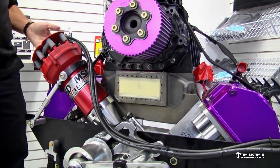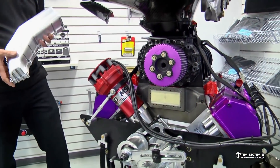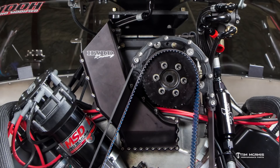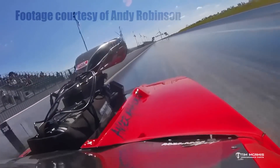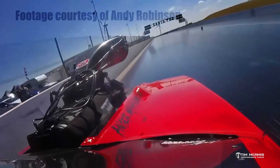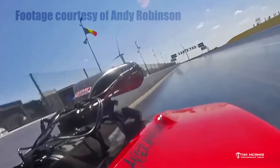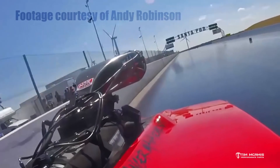We tried a couple of prototypes and didn't really like them, but we finally came up with a design that actually turned that chimney up and over to the side, routing it up under the hat over by where the throttle linkage is, and got it out away from there. It's a lot bigger than the one for the screw charger, but it works fantastic. If you look at some of the videos on our site of that thing in action, it has saved front end after front end. When you guys blow the front ends off these cars, it's lots of damage — it's hard to get back to the next round, it's just grief for everybody. So we designed that, it works phenomenal. It's two parts but it works great, and everybody who has a Roots has one. They've been tested over and over and performed flawlessly.